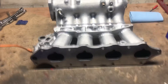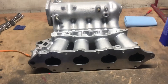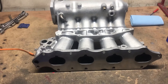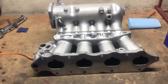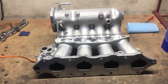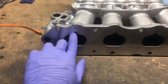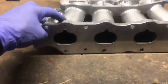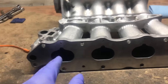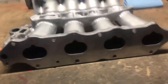What I'm going to show you today is what modifications you need to do to this EURR manifold to install it on your H22A1, H22A, F20B, or any H22 that wasn't a EURR head, because they have a different casting. The first thing we're going to do is open up the injector spray site, since the JDM uses a different injector and the spray pattern is a little more narrow than the USDM one.